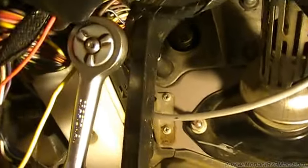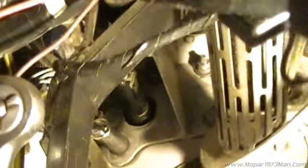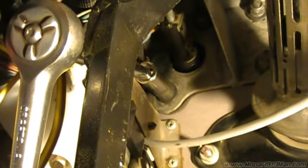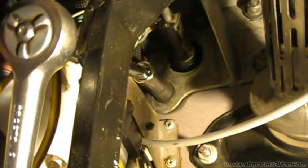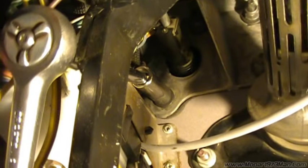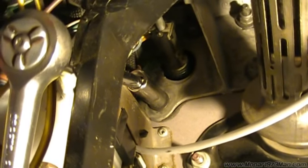Just to set up my ratchet so you can see where the bolt studs are — there's another one hidden up above. That's a 15mm socket I'm using, and a wobble extension just so I can get enough angle to get around stuff. I managed to get those two nuts out of there.